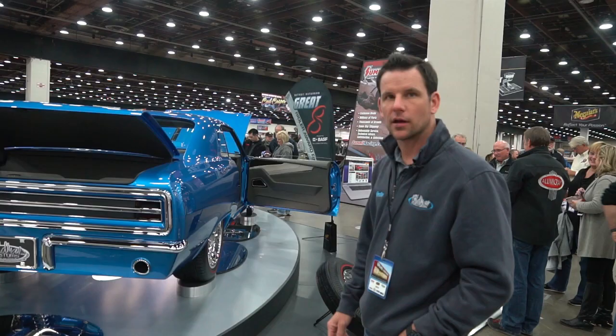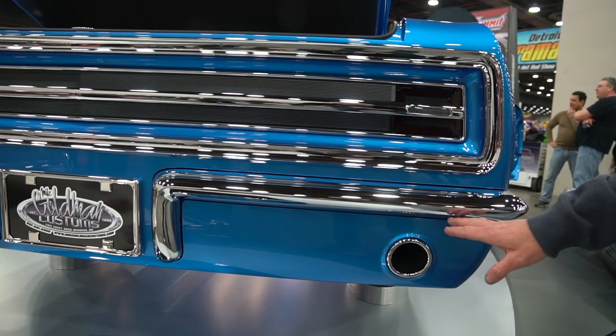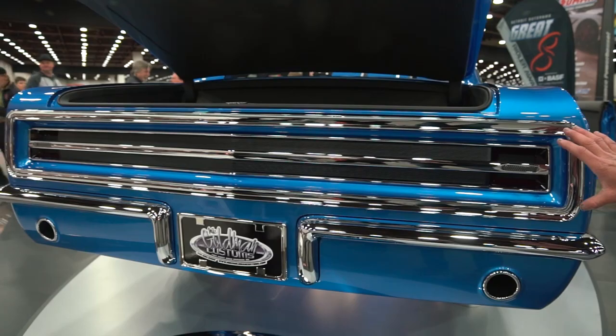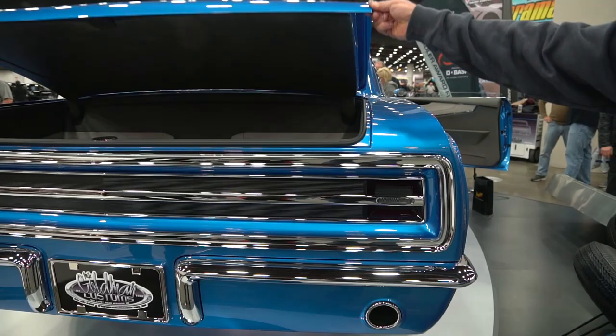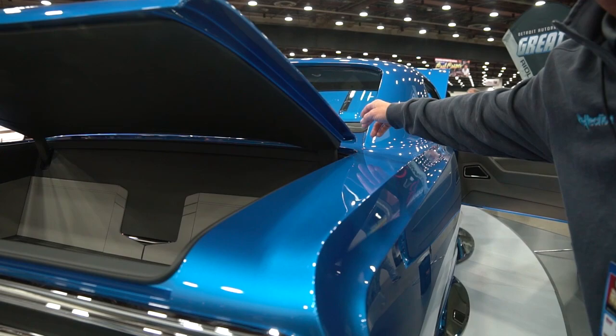The rear of the car — we basically started with the rear bumper. We tried to take the ugly off. This is the original profile of the bumper, but normally the original bumper protrudes down and rolls into the roll pan — which normally isn't a roll pan; there's no sheet metal down there. We've deleted that. Totally one-off bumpers. We did the one-piece tail panel, which normally is integrated in with the trunk. We took the trunk opening that normally comes out here and sucked it in to come in line with the sail panel of the '66-'67 roof.